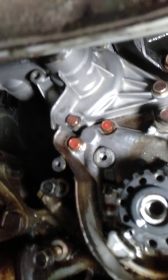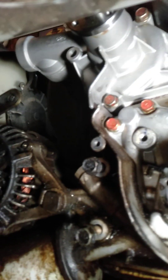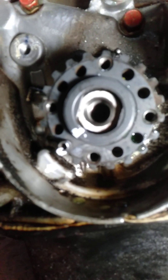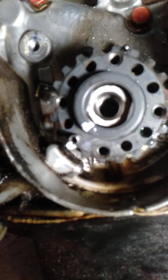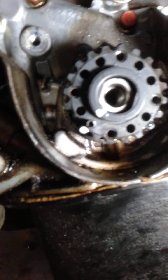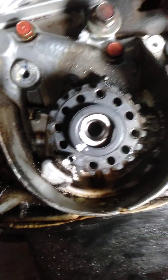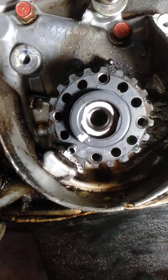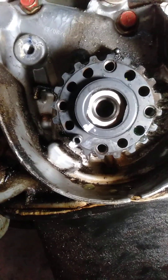There we have the new water pump installed — that's what it looks like, all uncovered. I've removed the timing belt, and you'll notice I've put some markings on the timing belt, on the sprocket gears — the toothed belt gizmo, that's the technical term. I've marked them in the positions they exactly were.